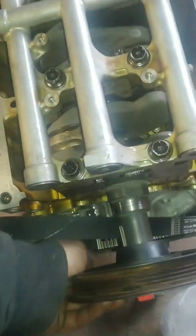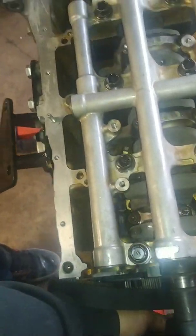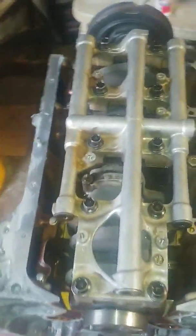I'm going to put this thing top dead center again, and then we'll put everything else back on — our oil pump, our side piece, our new seal, then we'll get our oil pickup, our tray, lay down some new sealant, and get the oil pan back on and go from there.